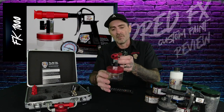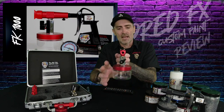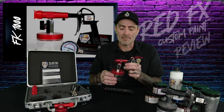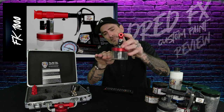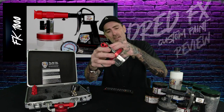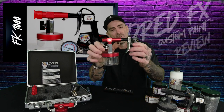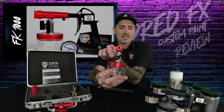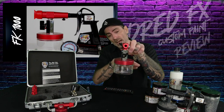So you've undone that at the front, and that makes that do this. So when you're spraying, that jar permanently self-levels itself like that, which I think is a good idea, because when you've got metal flake in the bottom and your flake's running down, if you're using it like a normal spray gun and you're spraying and doing this, all that flake's going to congregate to one side. But if you've got the valve undone here, this little catch, so that pivots, wherever you're going like this, that jar's staying at a flat level and the pickup staying continuously okay on a flat level.